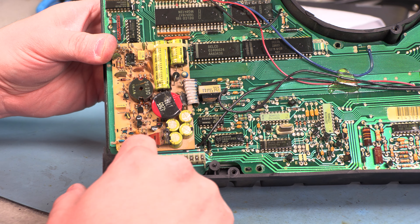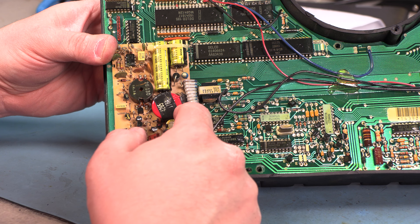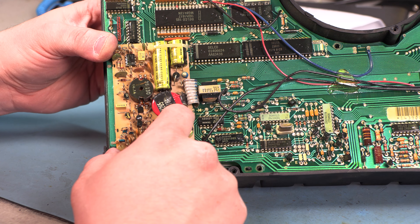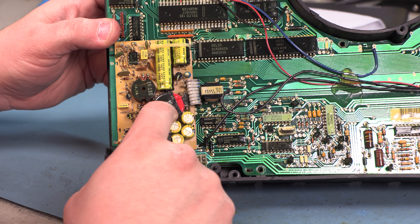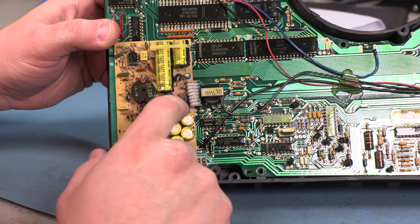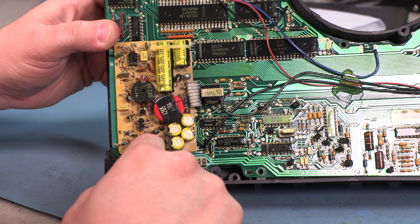At first look, I'm not seeing any melting of the 12-pin connector set, and I'm not seeing any leaking of the capacitors on this power supply. But I am seeing that this is a factory power supply. I always recommend that if we're going to keep the car for any length of time, we go ahead and replace the power supply proactively. These are failing at alarming rates. Replacing the power supply and rebuilding the backlight circuitry will probably give a cluster another 25 to 30 years worth of life.